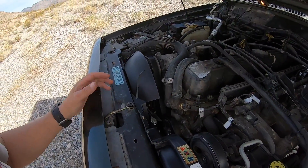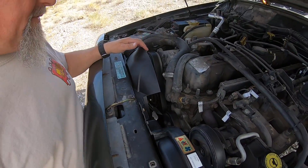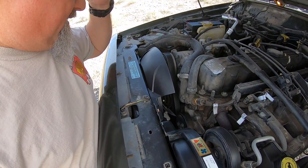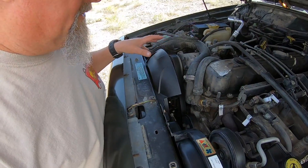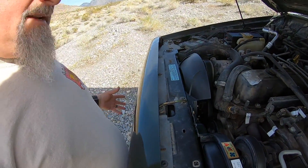Probably the most important thing you can do to make sure your cooling system is functioning properly is to make sure the fan shroud is installed. If it breaks, replace it. I should probably run this test again — take the fan shroud off and run it again to see if it overheats. I'm willing to bet it will. Everything under this hood after 20-plus years in the desert is going to be as brittle as can be. All that happened is the top piece of the shroud busted off. This fan needs the shroud to direct air through the radiator — without it, it's sucking in air from around the radiator and not getting enough flow through.